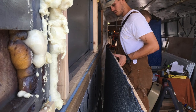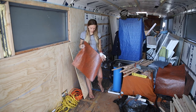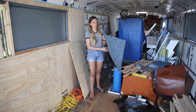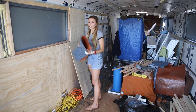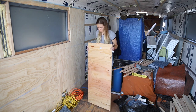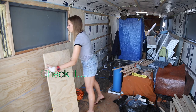What we put on behind the plywood was a three-in-one underlayment. Three-in-one meaning there's a moisture barrier, it acts as insulation with the fabric, and it also acts as sound deadening. In order to seal that to the back on the C side, we just used 3M's multi-purpose adhesive and it works pretty well.